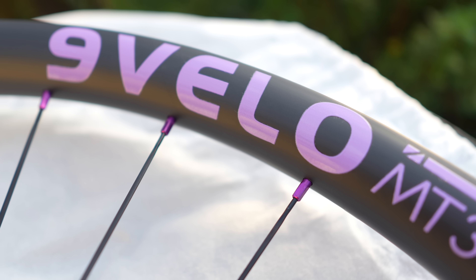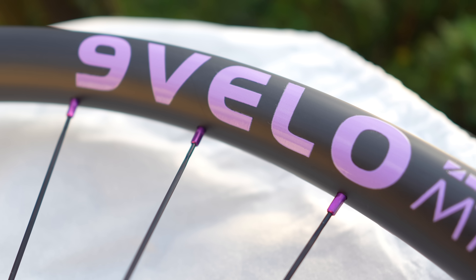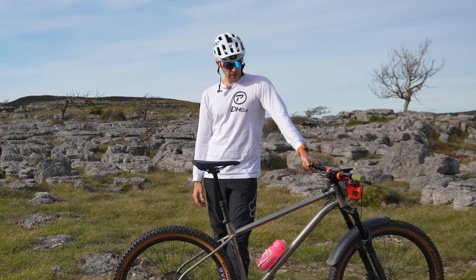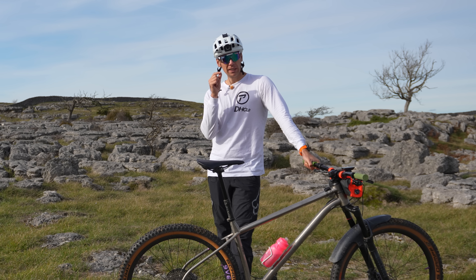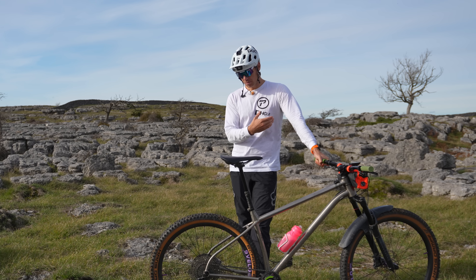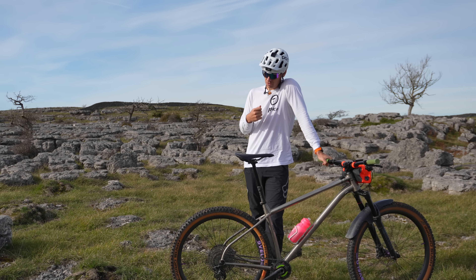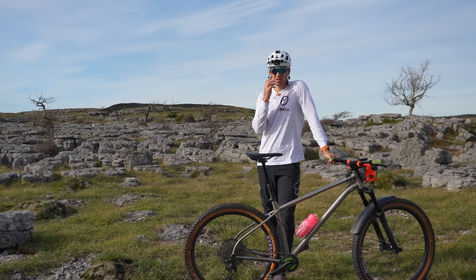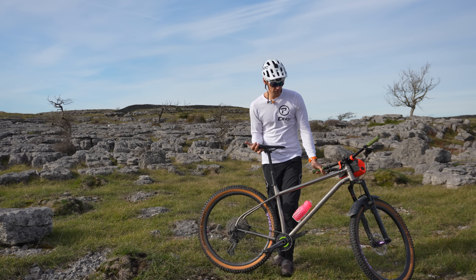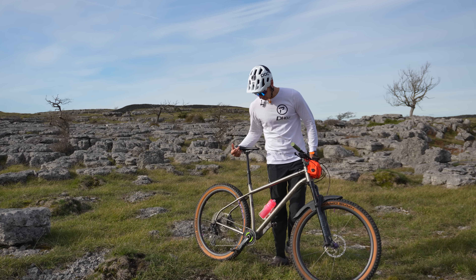Hopefully that quality is going to last — I've ridden them as hard as I can for the two months I've been riding them and I literally can't fault this wheelset. If you want, you could ask them for brass nipples for a bit more longevity and a safety net on serviceability — that would push the weight up about 20 grams per wheel, and obviously they won't be able to anodize them in these funky colors.